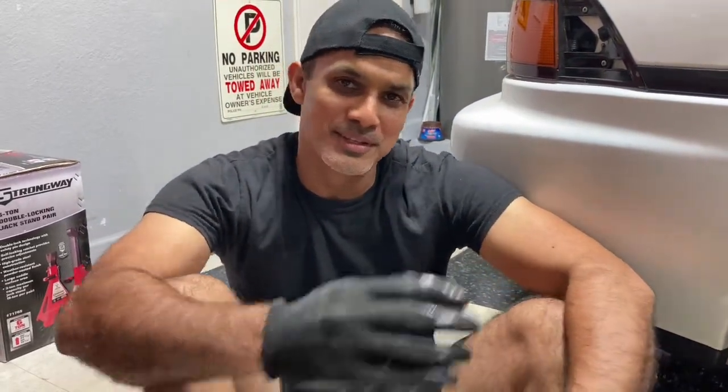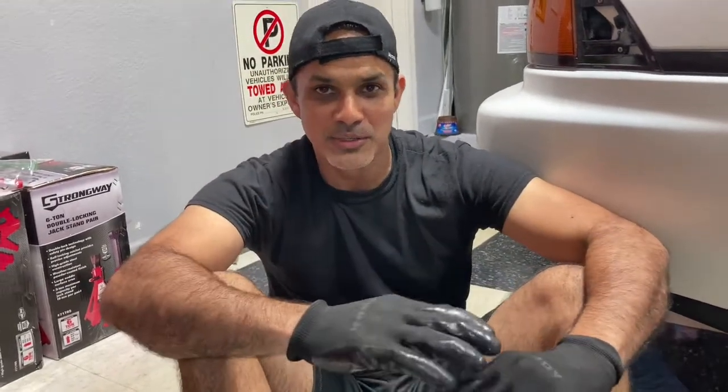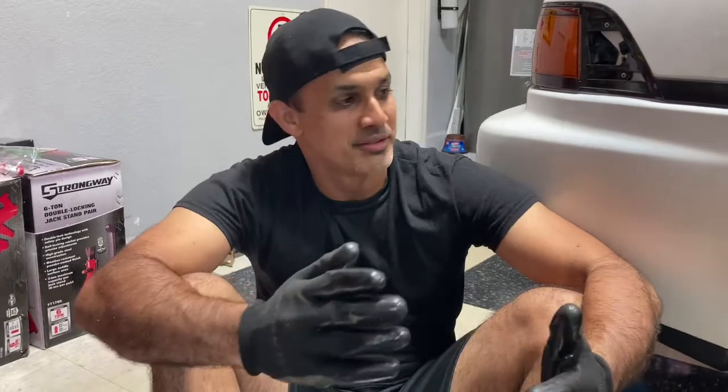Welcome back. Last time you saw me remove the stuff from the top of the engine, and we had the clutch lines left to go. So today we're gonna get the clutch lines out, fully disassemble that piece, and then the AC compressor. That's the only thing that's gonna be left on the top of the engine. I am actually gonna leave that for the very last because I want to keep that system fully closed until the very last. I mean, it's gonna stay open for a while, but whatever. I'm gonna leave it on, and then right before I drop the engine, I'll disconnect the AC compressor.